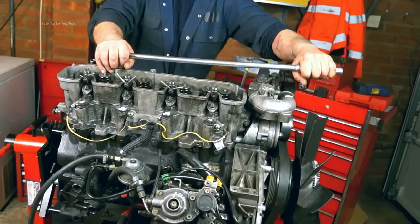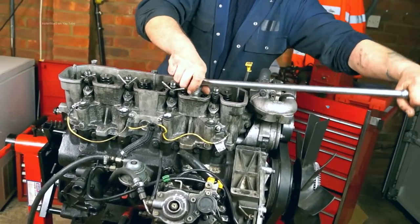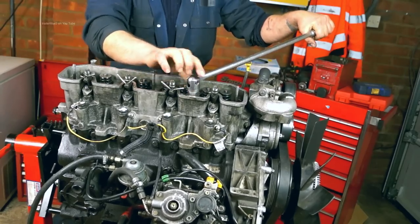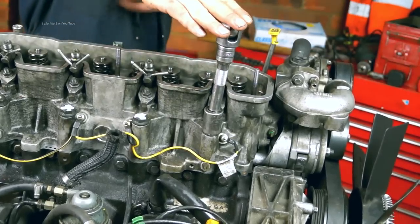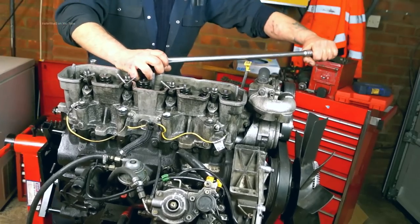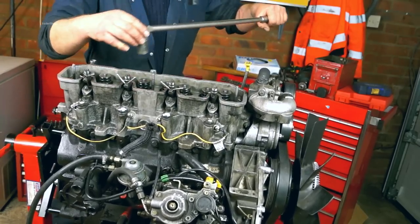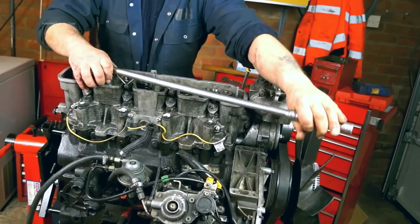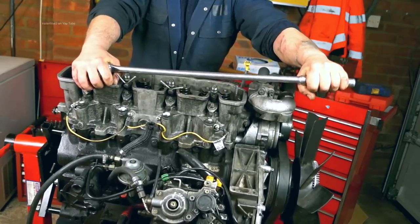What I would advise, first of all, is to just slightly wind the bolts off in the first sequence. Don't pay any attention to the sequence I'm doing here — I'm just showing you how far to go. To reach some of the bolts you might need an extension. I'm using an awfully long breaker bar, and the action here is pulling towards me at chest level — this will be the best way to do it. Don't do it at face level, just in case the socket slips.